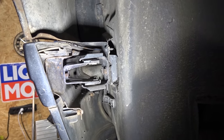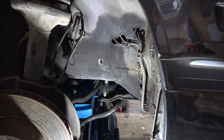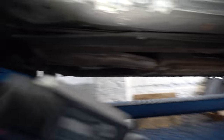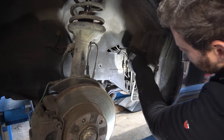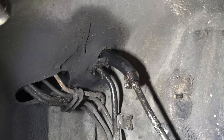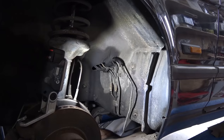The disc and pads have got to go. The brake line also looks good — that's probably been replaced, but for peace of mind we're going to replace it again. The dust boot turned into dust — you can see some remnants inside, so we're likely going to have to do something about that. This is the access hole — I'm going to remove this plastic cover and we should be able to see those lines. I just realized we're missing a fender liner here — look how much mud we have in there. But it looks good, no rust. That fuel line — you can see it's already leaking, so if I'd started the car like this there would be fuel everywhere. Good call on replacing this.